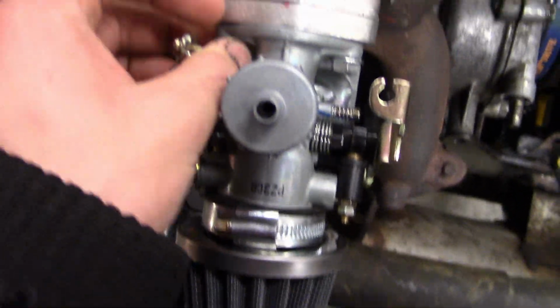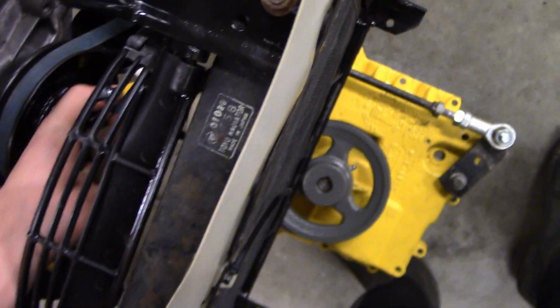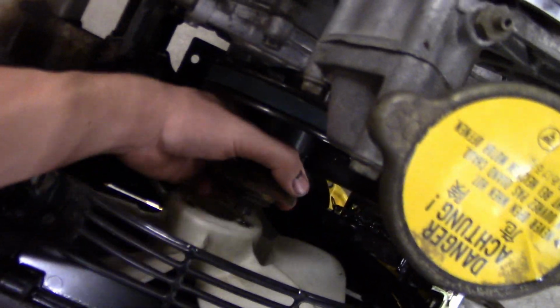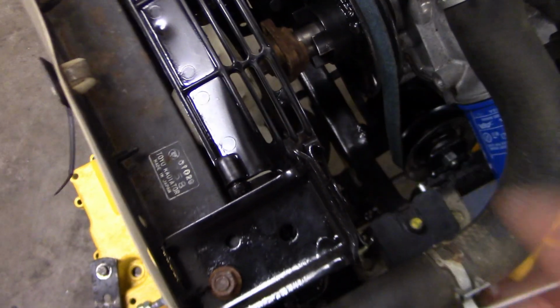These studs I have in here, the studs are not long enough, and it's really hard to find two-size studs because that's 5/16 and this is quarter 20, I think, quarter 24. When I turn that, it's also turning that the direction it should be, and then push the clutch in, and this should break free like that. So now it's just down there free spinning, let the clutch out, tightens up again. If it's in gear, it's going to lose traction instantly, but another problem is when I push these in, the belt kind of falls out of the pulleys. I've got these little belt guards that will keep it all nice and tight and should disengage pretty quickly.